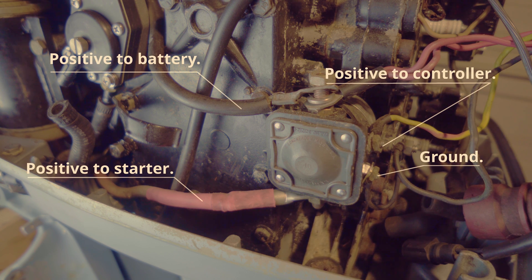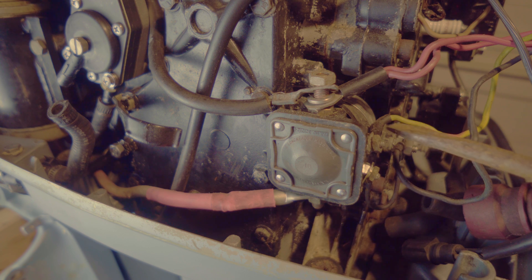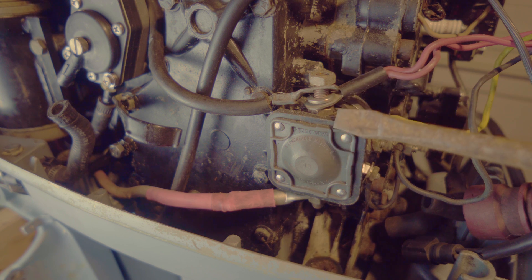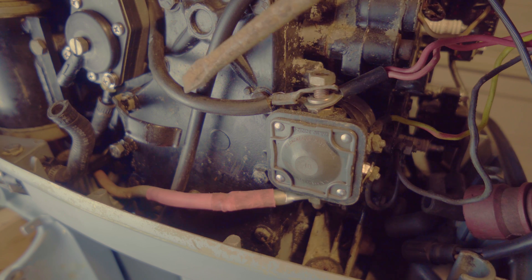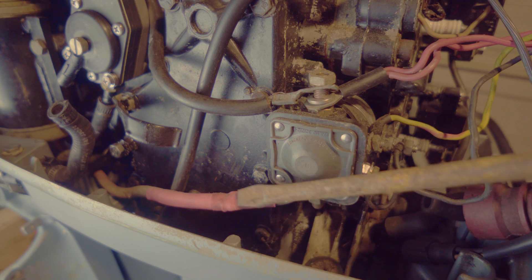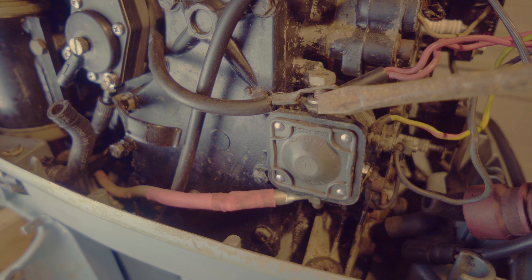I have a friend who has a much more expensive boat than me, and one day he had to get towed back simply because this yellow wire had fallen off. When you turn the key, this wire gets voltage which engages the solenoid. The solenoid basically acts as a relay — it connects the power from this cable, which brings power from your battery to your engine, and this cable below goes to your starter over there. So when you turn the key, it allows the current to pass from top to bottom, turning your starter.